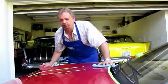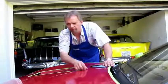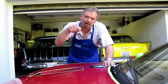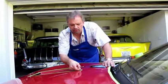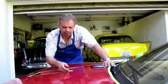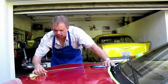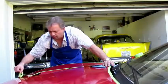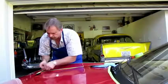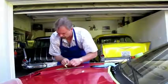We've finished the whole color sanding process. Everything is dull with 3000 grit scratches all over the hood, all done in straight lines. Now I want to show you how to take off this tape. Always peel the tape down — never peel it up — because you want as little tension on the surface as possible. This car's never been repainted, but we don't know if there's an adhesion problem. So peel like this, leading the tape all the way around the surface, and do it slow. No reason to jerk the tape and pull hard, especially on all these sharp edges.